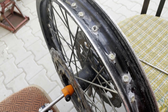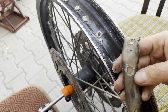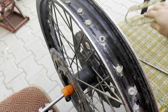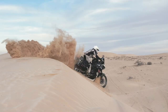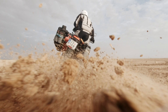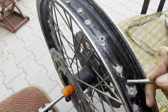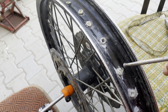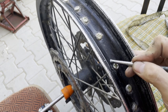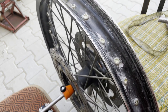There's a massive hole in the rim — this whole thing can just go. The corrosion is all over the rim, not just one spoke or one nipple — it's on many many places. The spokes are of course loose because of it. What I think happens is: any tape — this is Outex, could be something else — seals in there very well but does let in some water and dirt. In my case I suspect this is corrosion from salt in Tunisia, because you basically bathe the whole wheel in salt and you are not able to wash it off from inside when it's under the tape.